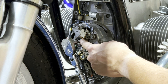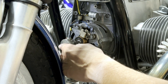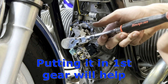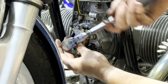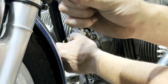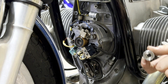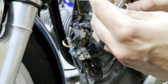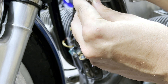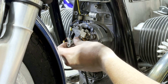And then we're going to undo our center crank nose bearing bolt. This is a six-millimeter Allen. As you tighten this you're going to be rotating the engine, so what I like to do is just put it on a compression stroke right there and then just kind of palm this ratchet, and then you'll be able to break it loose. Once we get this undone, we are going to be installing this little spacer here that's going to have our little plate that is going to communicate with the optic. I will put the supplied lock washer on there, as well as just a very small amount of the supplied Loctite, and right back where it came from.